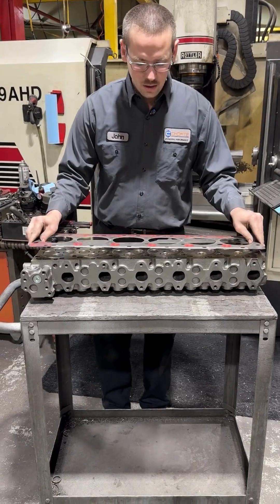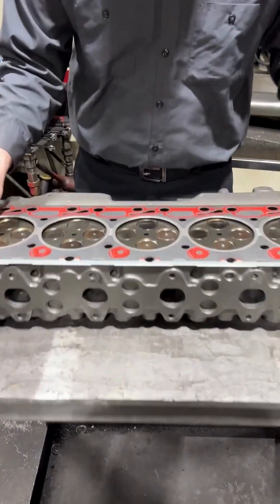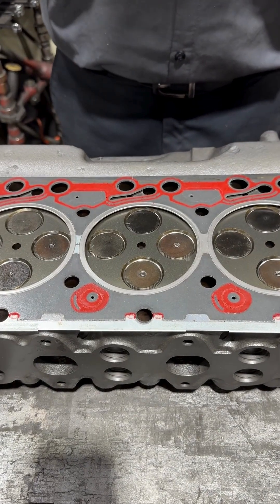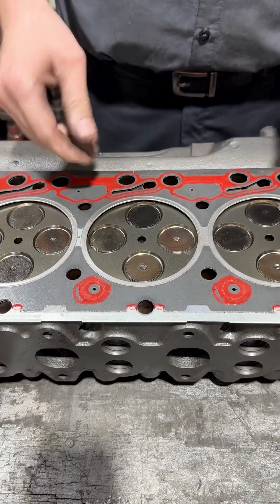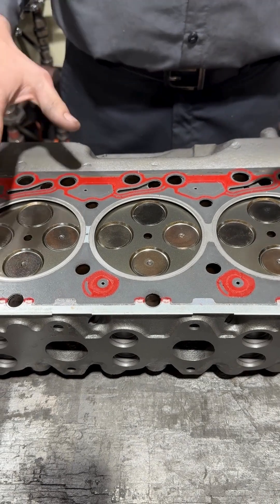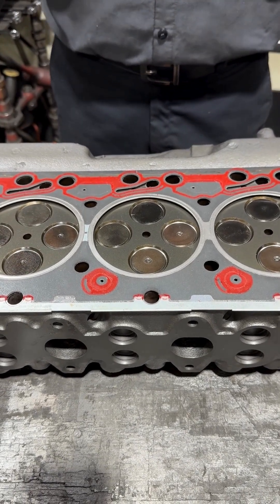So if you come in here, you will see as I lay the head gasket down — the O-ring will actually be pinching down around the fire ring right here underneath the head gasket. And the reason for that is to pinch down and make sure you've got a tight seal, and to keep it from moving around so that you can make more boost and more horsepower.